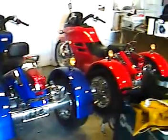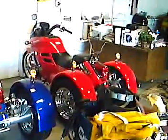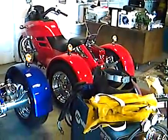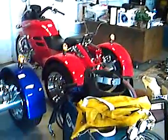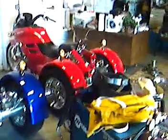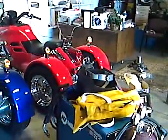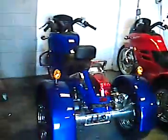There's the MRP exhaust system — that's all you can see on the bike because these are totally enclosed. They're beautiful bikes and they perform very well. There's the cherry red one. That's got every part you just saw, plus some. It has the variators, it has the MRP Kevlar-assisted belt, it has the heavy-duty clutch with the heavy clutch springs and extended springs to allow it to stay in the lower gear longer. That's a real good feat for MRP Speed accessories to make this bike go at a red light just about as fast as anybody else. MRP Speed, thank you for that blue one. MRP Speed, thank you for that red one.